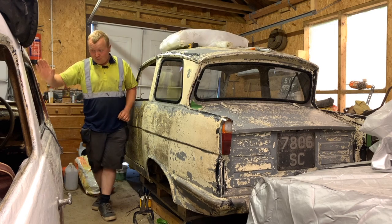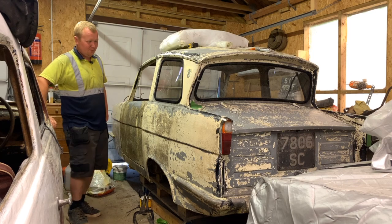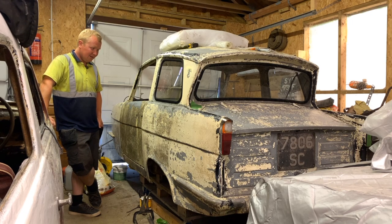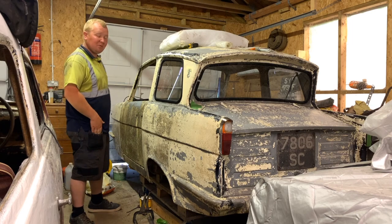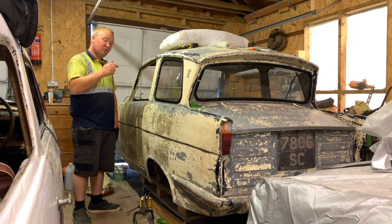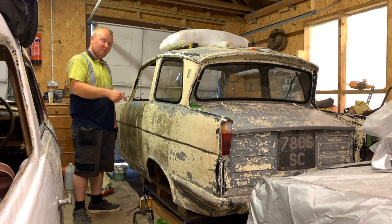Not the Mark V, which is sitting here, but the 325. A small fact about the 325 actually, since it just jumped to my mind. They were called the 325 because they were 3 wheels and 25 horsepower. Quite a nerdy little fact maybe, but just to establish a little difference between the Mark V and the 325, as well as that's a side valve and this is an overhead valve. In fact, it was the first mass-produced aluminium overhead valve engine.